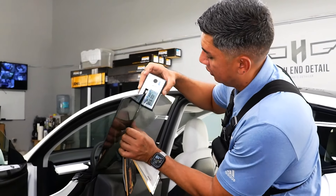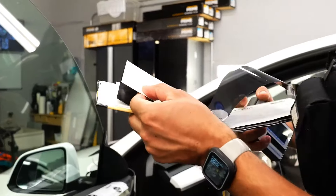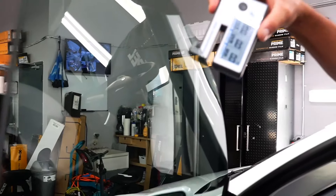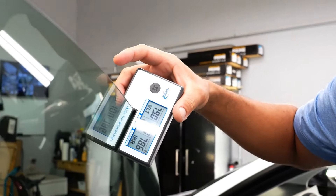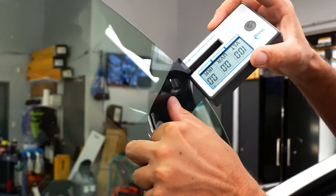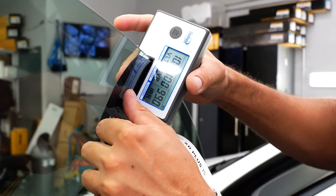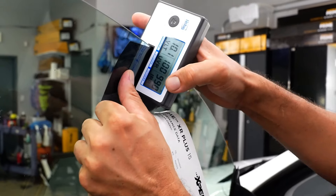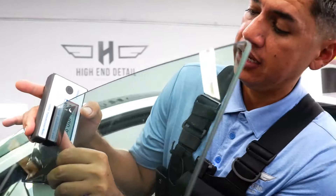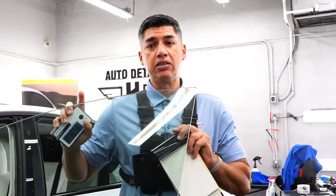15 percent is what it is on the back. Then if I put the 15 on the front clear glass — which measures about 79 — you can see my 15 film brings it down to a 10 percent, and the infrared number shows 99 percent being reduced. But even though it reads 10 percent, because you have a light interior it's going to look more like a 15.